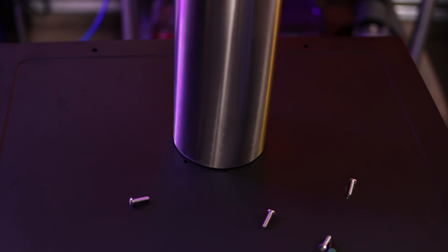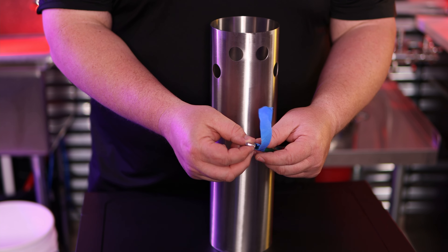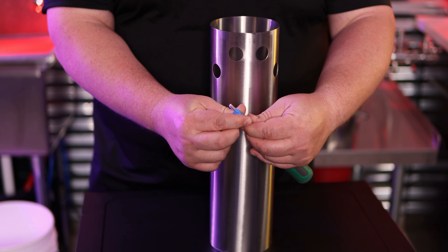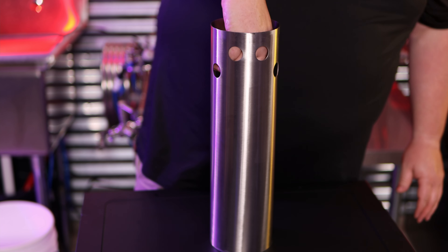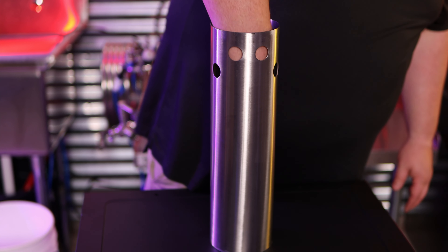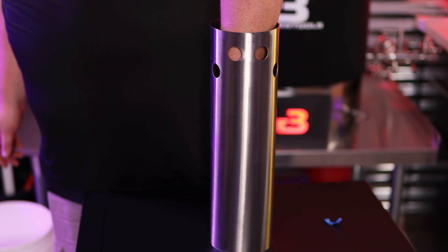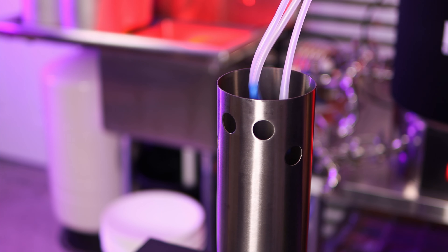This was one of the most difficult stages for me — screwing down the draft tower. Remember the screws are on the inside. Since this model takes four screws, I used some painter's tape on my screwdriver and taped the screw on there so I could stick it down in the hole. I usually don't have trouble finding the hole, but you need tape or a good magnetic tip. Just stuff your arm in there — once I got the first one I got the feel of it and things went quickly. Just get everything nice and tight and be patient.